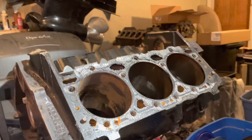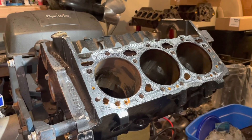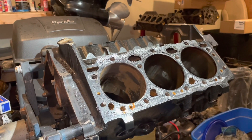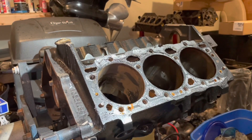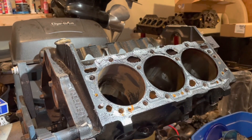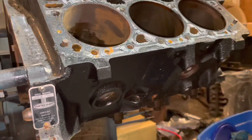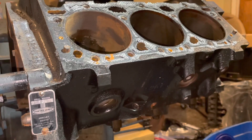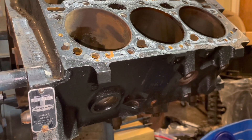That's about all I want to say about converting car and truck engines to boat engines. To summarize: you want to use Vortec heads if at all possible — even if it costs you an intake, it's worth the 20 or 30 horsepower it gives you. You want to make sure you use a marine cam; don't use the car-truck cam — you could, but you won't have as much power. Don't forget about brass components that touch water. On your bores, open them up about a half a thousandth — no more than a thousandth. And for bearings, I follow the MerCruiser service manual specs — as long as I'm in their tolerance, I'm good.